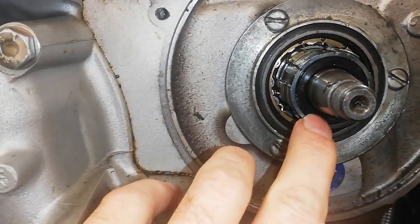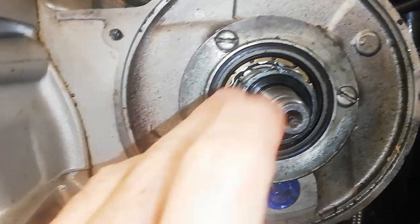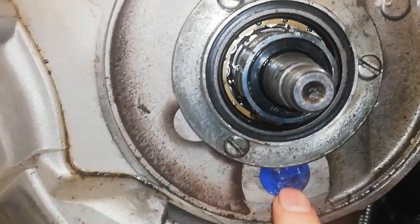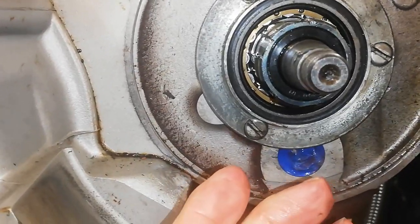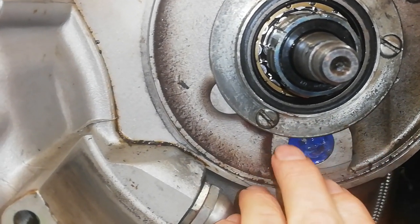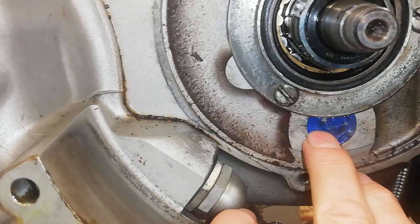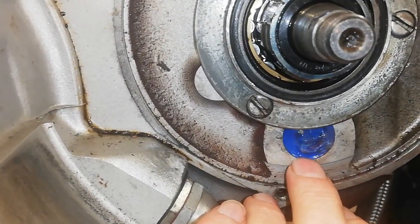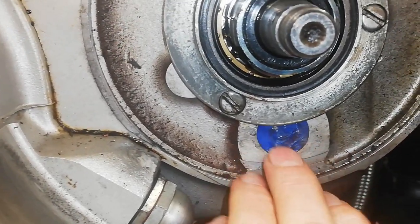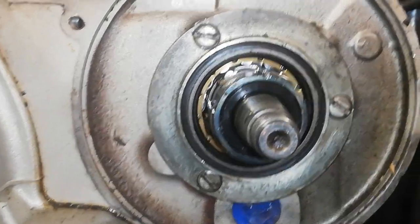There's also an oil seal in the top of the high gear, but I'll leave that in — it's difficult to get out and I might replace it anyway if I do melt it. The back end of the lay shaft has a needle roller bearing; that isn't a blind hole, it's a closed bearing that makes a seal. I've put some extra gasket sealant — looks like blue Hylomar — just to ensure that doesn't leak. That other hole is the blind hole we're going to heat so we can remove the selector fork shaft.